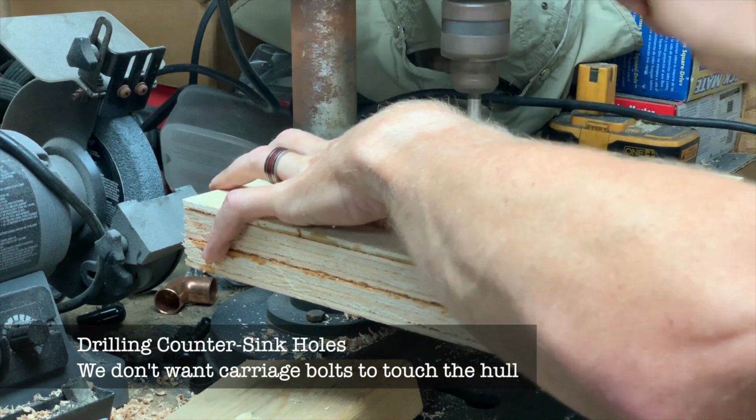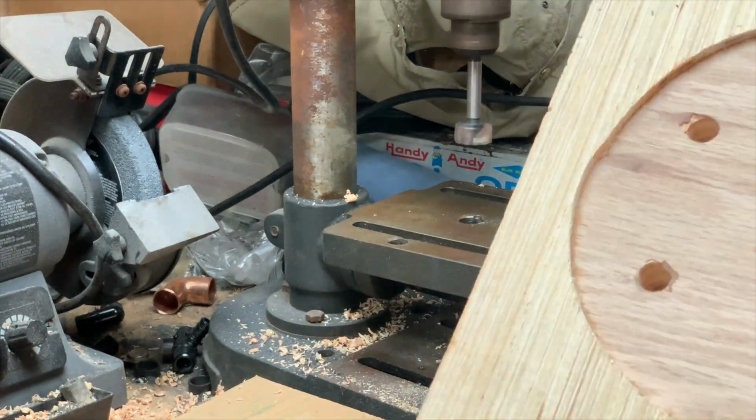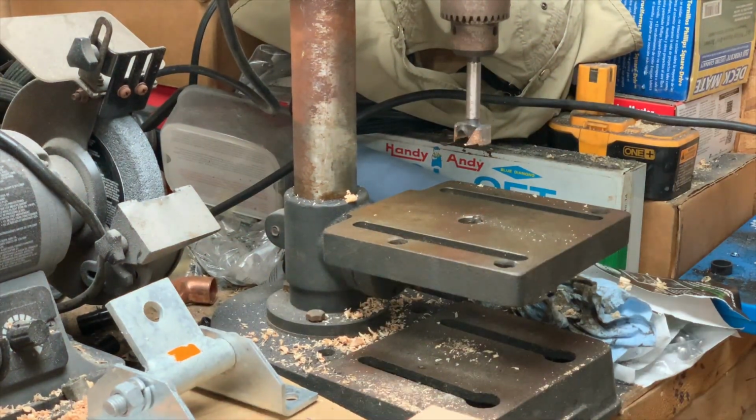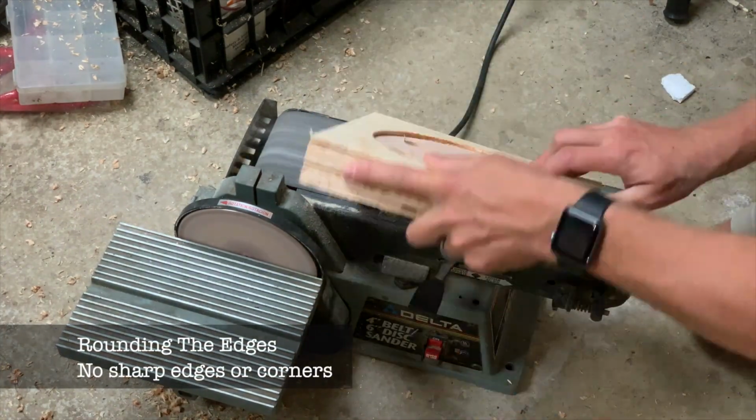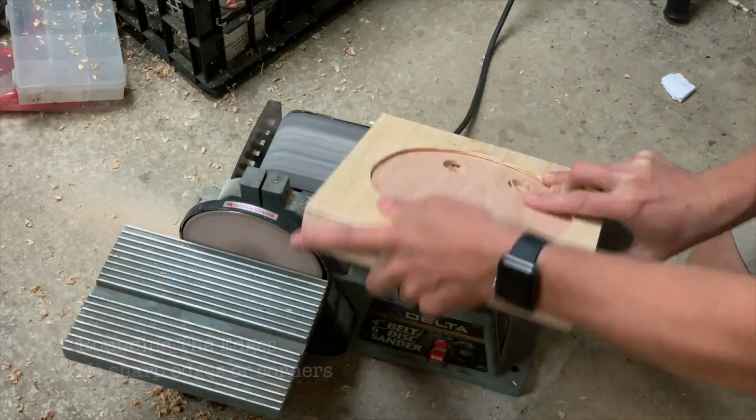So I had to put these 2 pivot brackets. These are actually meant to be used one at a time, but using those and a bunk stiffening weldment in between them, I was able to turn the axis of rotation by 90 degrees to the direction I needed it.